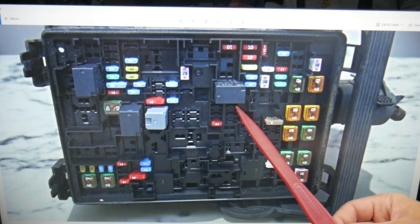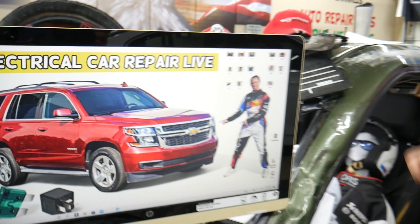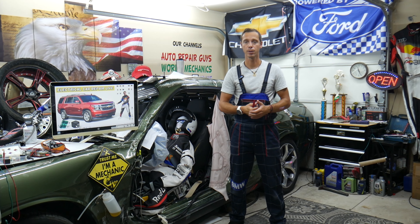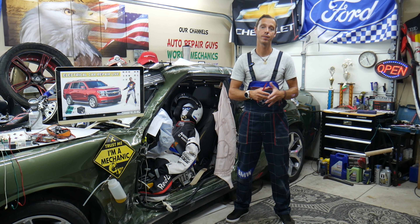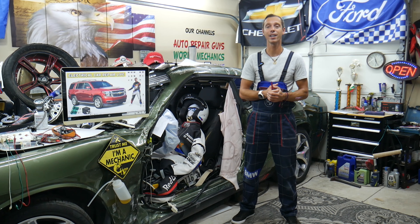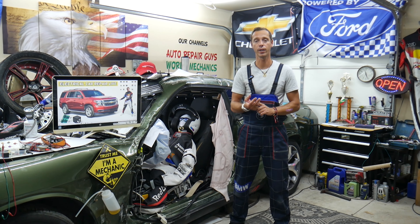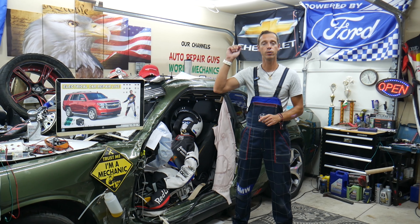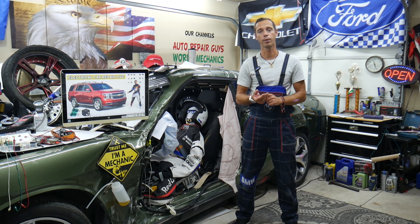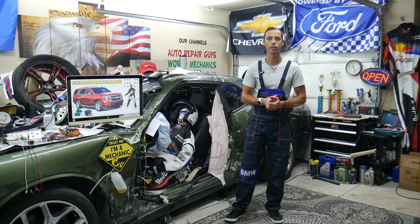Here, you don't have any replaceable relays for the radiator fan, but on the bottom side of that fuse box, if you take it apart, you have some relays that are actually integrated into the fuse box board — they're not replaceable, they're practically welded there. If you're a professional, you can remove and replace them, but most likely there is a chance you have a relay there for the radiator fan. Always test your radiator fan. We'll have videos on our YouTube channel on how to do that. The radiator fan control module can also be the cause — we'll have videos on how to test that as well.